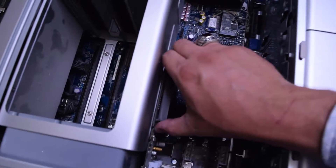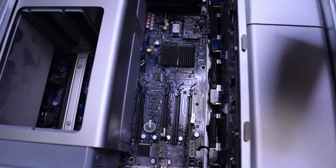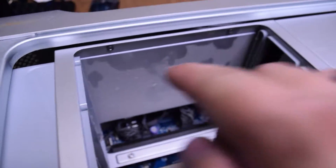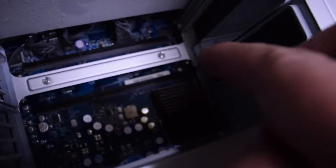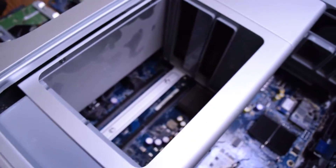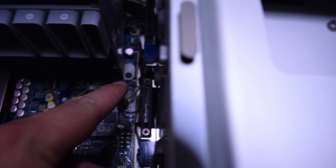Be careful when you're doing this — be very gentle, use both hands, and go ahead and pull that right out. For our next step, we'll need to remove the five Phillips head screws: two on the side of the bracket, two long Phillips head screws on the bottom of the bracket, and one Phillips head screw securing the fan assembly, the system fan.